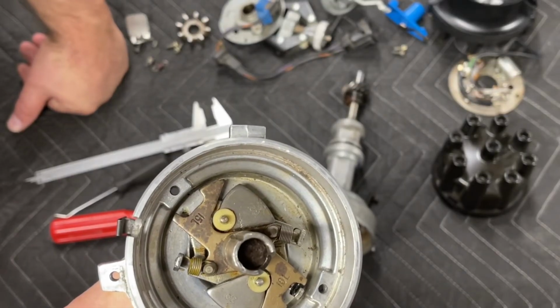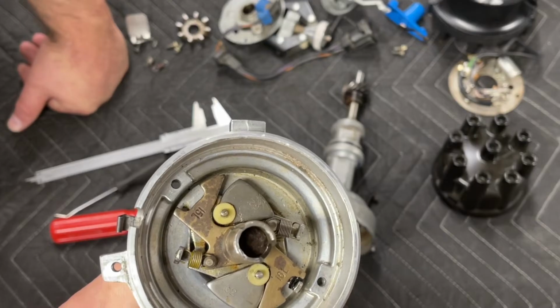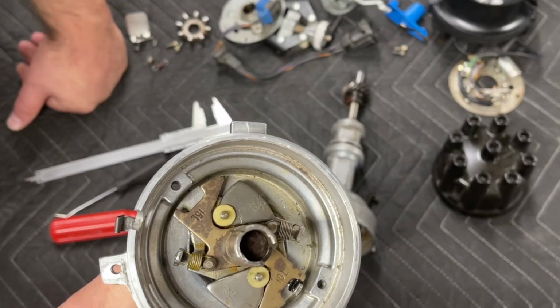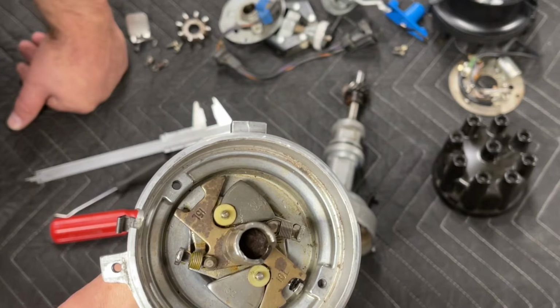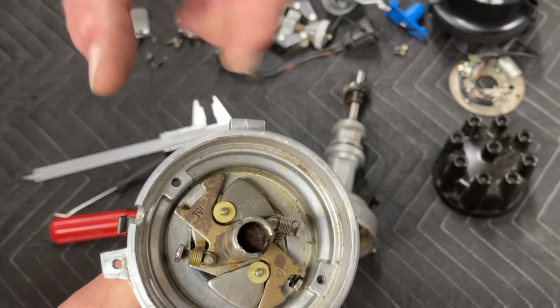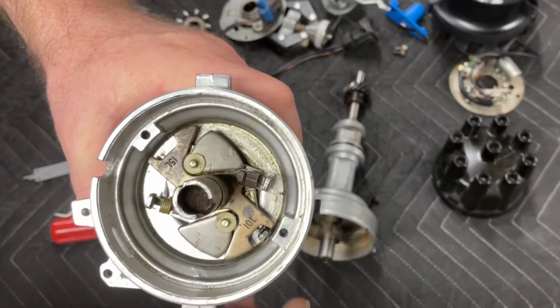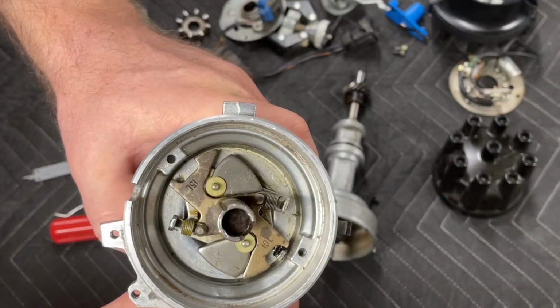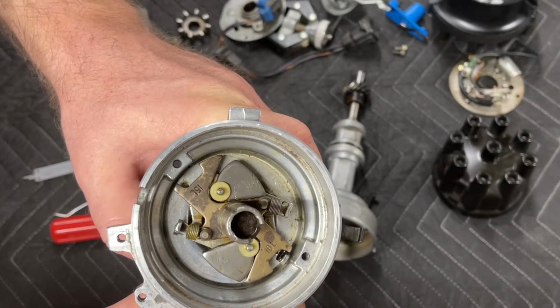Okay? Once you remove 1 gram from each weight, put it back in, take it out, and check your timing. And I'll show you in my next video how to check the timing. You can fine-tune the curve by fine-tuning these weights, and that will give you the exact curve that you want for your application every time.